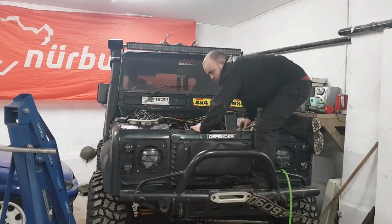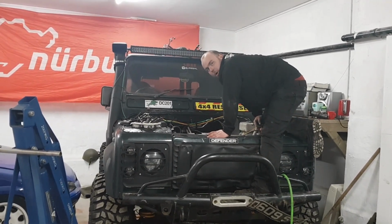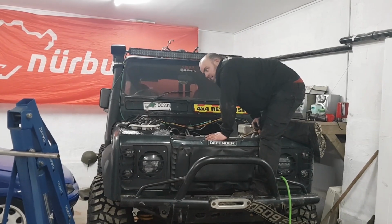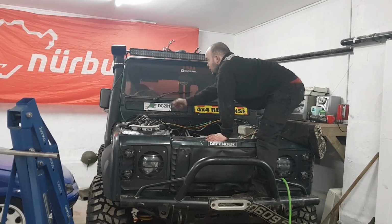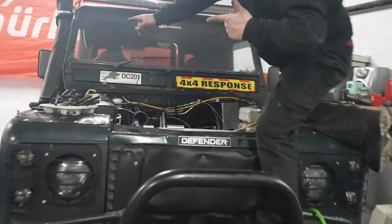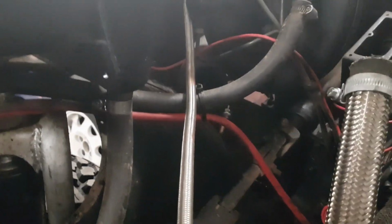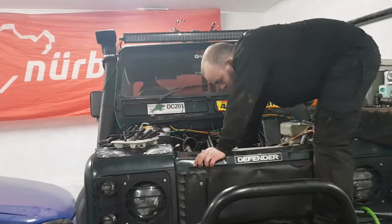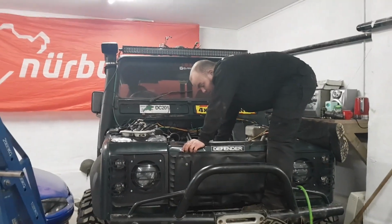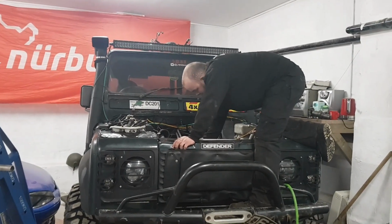If it was a proper off-roader, it would have lived. But then I have ordered 2.5 metres of 4-inch polished pipe, 90 degree bends, so 1, 2, and 3. We'll bag off that snorkel. That's for sale if you want it. What, you're not using it? It's too small. So you're going to have to make a custom snorkel. Yeah, anything less than 3-inch, 3-inch included, chokes, and it just can't get the air.